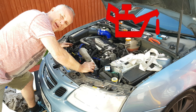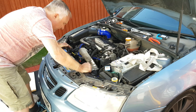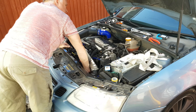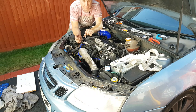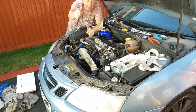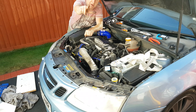Start your engine and make sure that your oil pressure warning light on the dash behaves exactly as it should — make sure it goes out within a few seconds of starting. Then with the engine idling, have a look and a feel and make sure there are no drips you can detect. Assuming you can't see or feel any drips while the engine is running, hey presto — job is a good one. If you've got any experience to add, put it in the comments section to help out the viewers, and I'll see you next time.